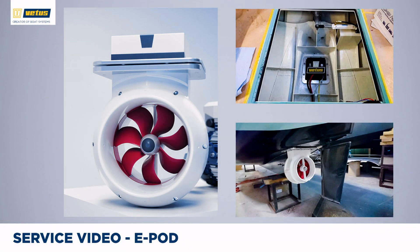The e-pod is a completely different solution. Most of the e-pod motor is fitted underneath the waterline. Looking at the image on the left, the blue line is basically the bottom of the hull — anything below the line is under the water level, and anything above is inside the hull. On the right-hand image, you can see the white e-pod and a rudder blade, all mounted underneath the water level.